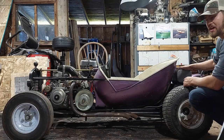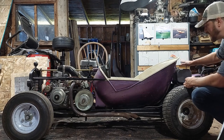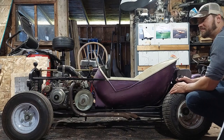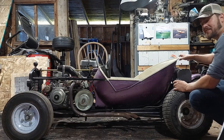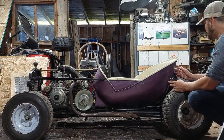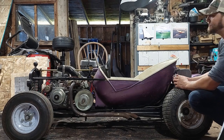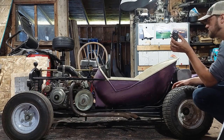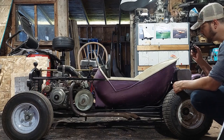Awesome. We lowered the fuel tank from where it sat before, which was up about another 3 inches higher. And that 3 inches really made a difference. Now our tank's sitting just about level with the carburetor. It's a slight bit higher, but I'm pretty confident it's gonna have fuel delivery issues. So I have a pulse pump. I'm gonna put this on, run new fuel lines, and then we'll get on to installing the new brake line